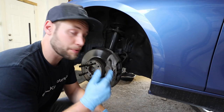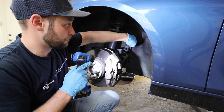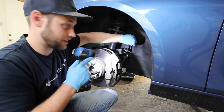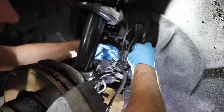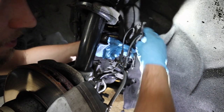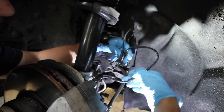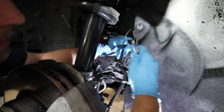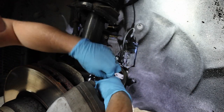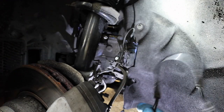One quick thing I want to note: I've been working on the passenger side. If you're starting on your driver's side, don't forget to remove your brake sensor. Your brake sensor is this one right here. To get this off, just open this little box — there's a sensor right here. You pull this out from its clips, just like that. This sensor has a little tab on it; you just press the tab and slide it out. Continue to un-route this, just like that, and that'll prevent you from damaging your brake wear sensor.